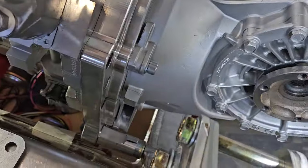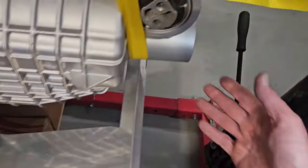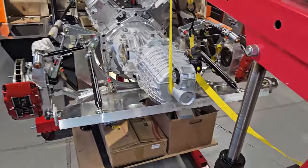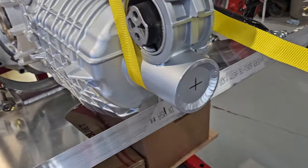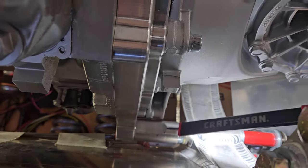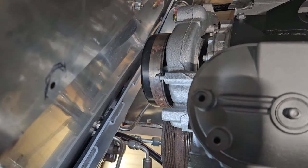So I've played around with the fitment, and you can see that I have a stack of washers in there. And that's moving the engine ahead a little bit. And that helps me out back here, the transaxle. I actually cut this off. So by cutting off about an inch off the end of that transaxle there, and by moving the whole assembly, engine and transaxle, a little bit, and I do have room in the front, hard to see, not a lot of room, about an inch.